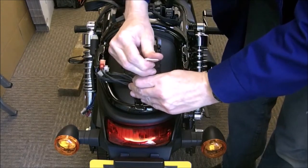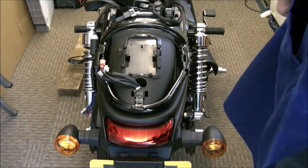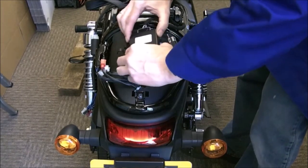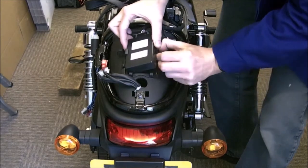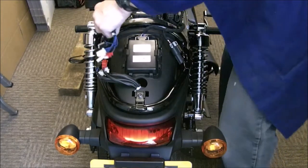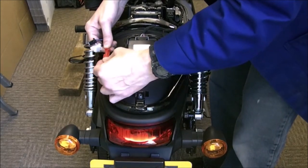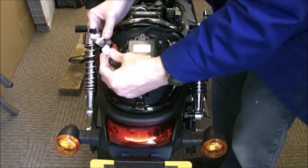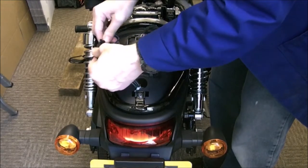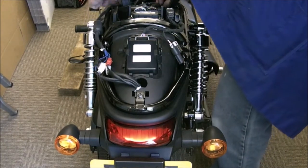And there we have it — all right, done. Make sure everything's okay with the camera. Let's kick the alarm system back in place — be careful with these, because you don't want to break these tabs; breaking them once and God knows if you can get that tray. Let's put the lead back up — can't mix these up: burnt orange to burnt orange, triple white to triple white, double white to double white, and double black to double black. The leads are awkward the way they're laying in — they are, they are rock solid.